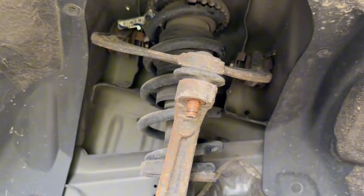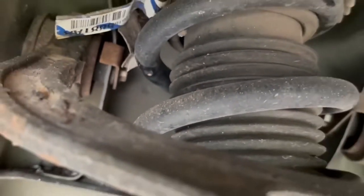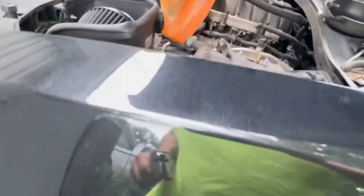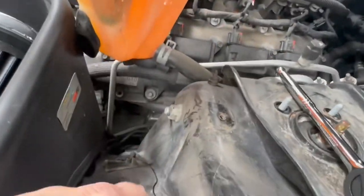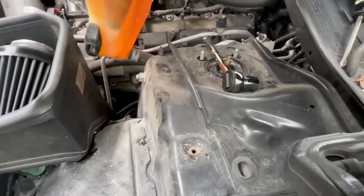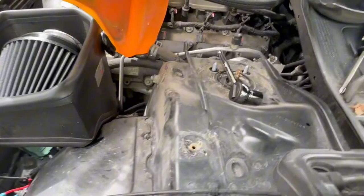For the driver's side, for the upper control arm, in order to remove those bolts up right there and then right there, first you're going to want to loosen this up, probably not take it off all the way. Then on the driver's side, you're going to come in here, remove your coolant reservoir - it's going to sit right here just like this. You're going to remove those; it's a 10mm bolt. Carefully set this off to the side so it doesn't leak coolant.